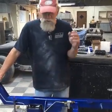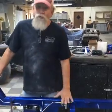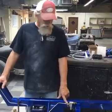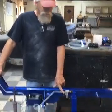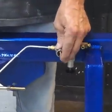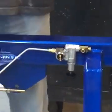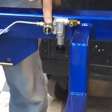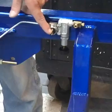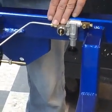Your back brakes are going to want to lock up before your front ones, and it's a proportioning valve. It's to keep the brakes stopping in the proper proportion. We use a pressure switch for the brake lights. Off an old maybe '50s Chevy truck, I think, they have lever switches. You can use that too under your pedal, where the pedal actually comes down and pushes a manual switch. We always use the pressure switch. Once you get pressure to it, it makes a negative ground and turns your brake lights on. When the pressure is off your brakes, brake lights go off.